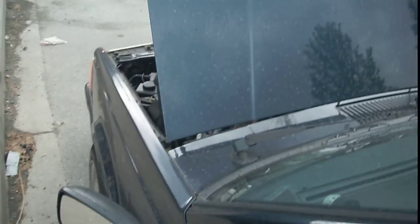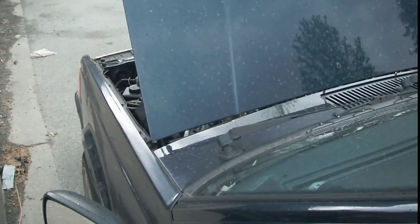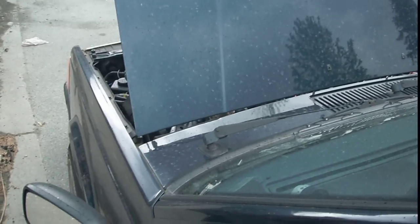This car's running 17 pounds of boost. I always run 94 octane because you don't want detonation — you're gonna keep it all good.